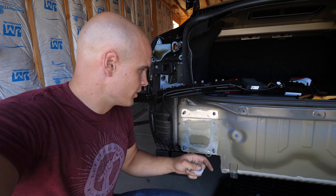With the hole there, this can slip inside and protrude out only when we actually want to tow something. When we're not towing, we can take it out and it's hidden, and the Model 3 looks like it has no hitch. Probably the scariest part of this ordeal is cutting into the bumper itself, but it's actually a lot simpler than it seems. We have the bumper off of the car set right here. To get the correct measurements, we're measuring from the inside of the car to the outside where the bumper is. Measuring along this center line, we're looking at 26.5 inches. The instructions say to put a dot 3 quarters of an inch from this center line, use a 4 inch hole saw and cut right there, then put another dot 2 and a quarter inches from that center line and use that same 4 inch hole saw. We don't have a 4 inch hole saw, so we used a candle to mark the diameters correctly and then used a jigsaw to cut the hole out — it accomplishes the same thing. And there we have it, perfectly cut for the hitch.